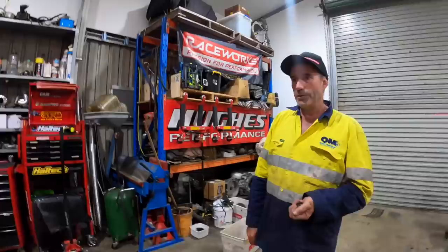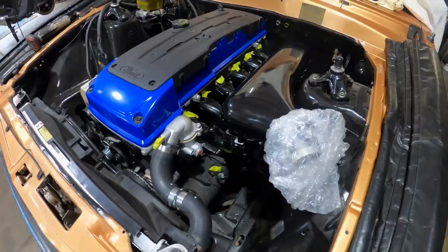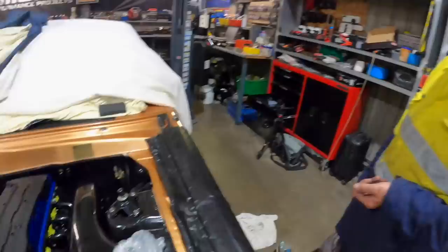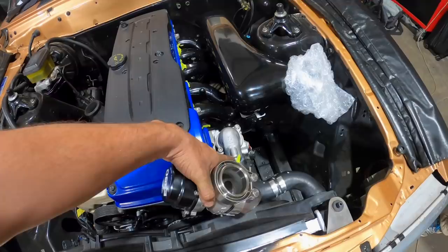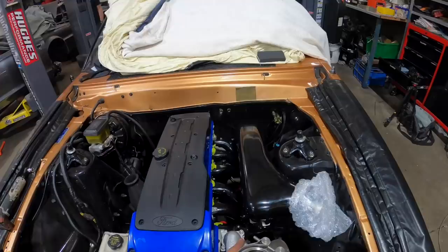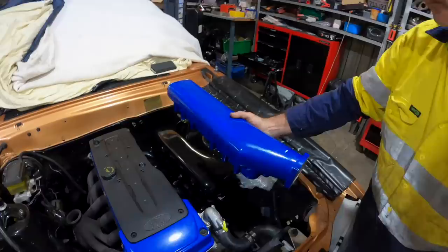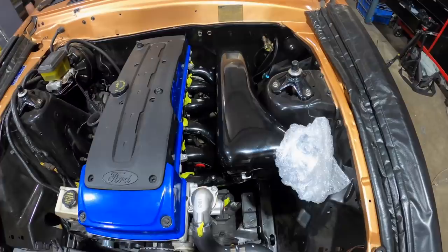This one's not going to be a dead sleeper - it's going to be pretty obvious what's in it. The whole radiator setup is a crash pack with a condenser in behind for air con, which we are putting in. The inlet manifold has changed - Wayne had a blue one which came forward but we changed that because it was going to clash with the radiator plumbing. This is one we learned from doing the Bedford - it's off an EB Falcon, forward-facing. Black looks so much better than blue. We do actually make these if you'd like to get one yourselves - our mate Danny has cast them himself.